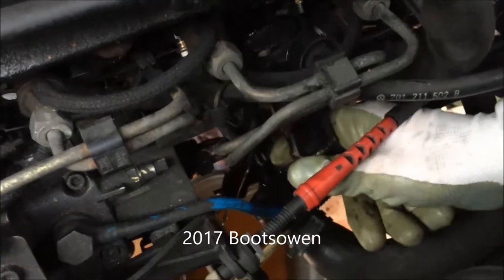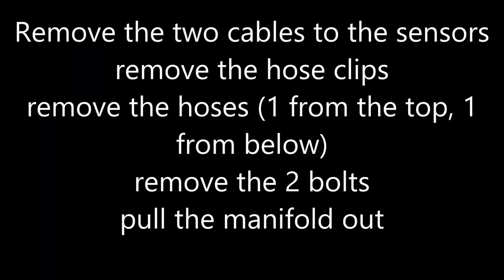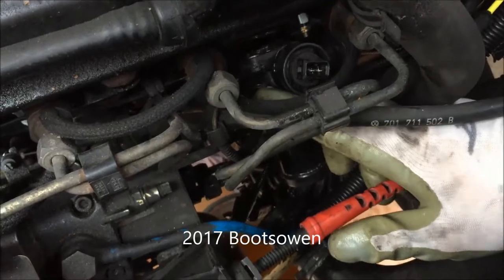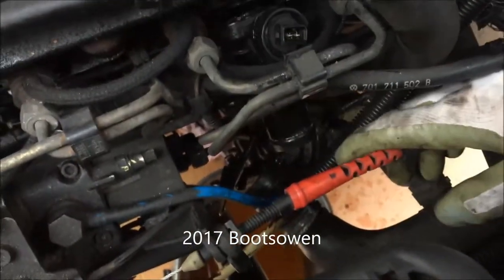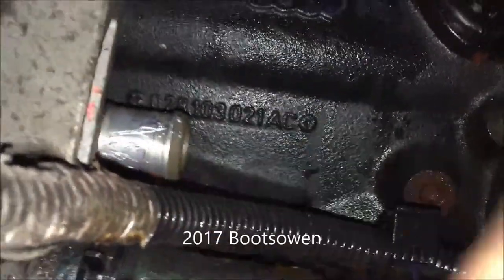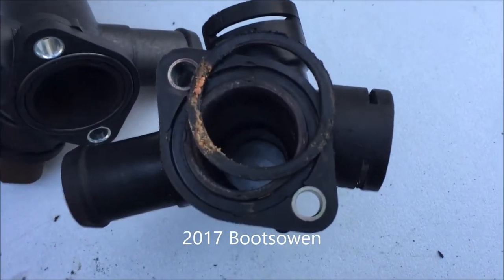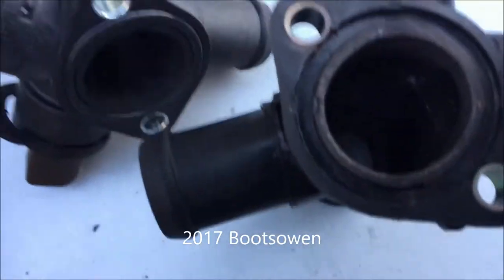What's going to catch me out is that I can't see to get the Jubilee clip that's on the bottom hose attached to the manifold. The bolts were quite easy to get out — they're just a 10mm head. On the left hand side where my finger is, there's a little earth cable that goes to there — you just have to disconnect that as well and remember to put it back on. In the end, the only way to get the manifold loose at the top, or to get the bottom hose off the manifold, was to release it at the bottom of the engine at the other end of the hose. Then it gave you a bit more space to pull the hose upwards, and that worked.